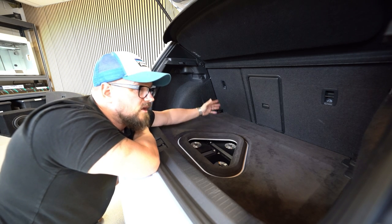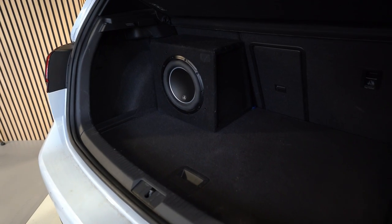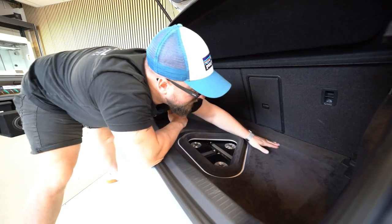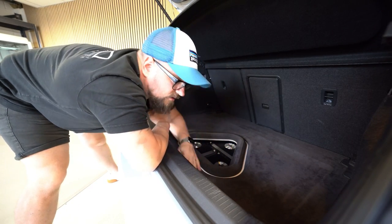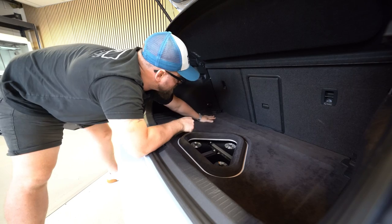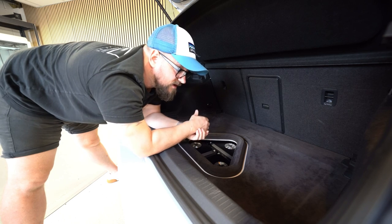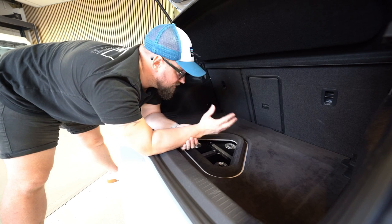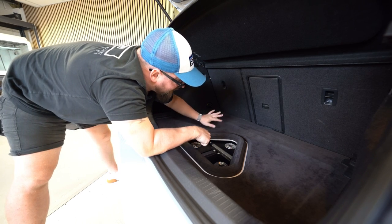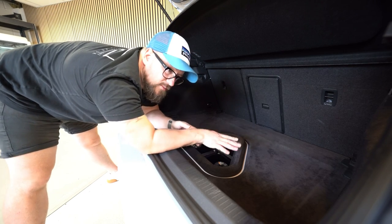You can see these mounting points because I run a passive 10w6 as the subwoofer for this system, and I like it in a box so I can take it out, put whatever I like in the car, or swap it out - I'm constantly swapping subwoofers. Things you might not notice, like this internal scallop shape - it's all dipped in and ridged down. None of this is flat 2D panel work; it's all three-dimensional. There are nice little cues there for pro installers and advanced fabricators - these little kicks and bends, all at the same angle.